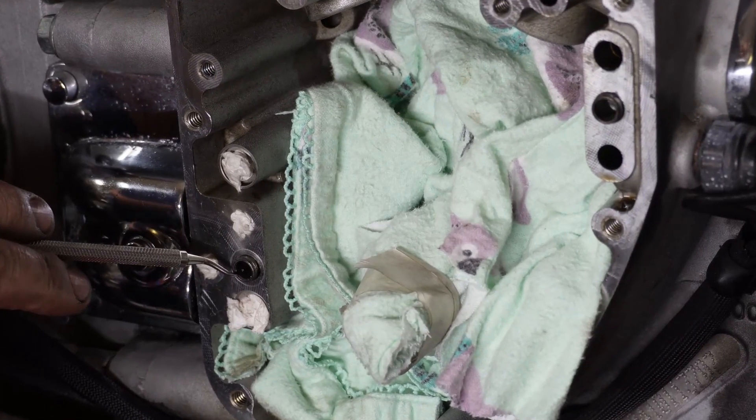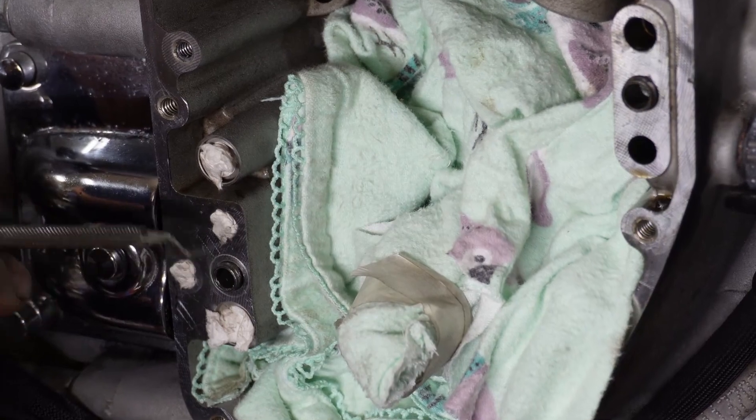While we were working on it we ran across a problem — this was unusual, but I have run across it before on some bikes. Other people may run into this if you happen to get your screws mixed up and try to put them in and strip things out. We had the case stripped on this bike in behind a dowel which had threads behind it, and you couldn't get a tap in it. You could try to put a wrench on the dowel and possibly crush it out or do more damage to the face where it's supposed to fit.